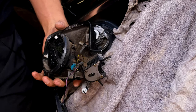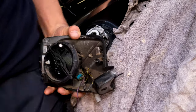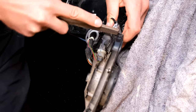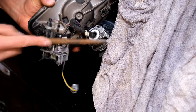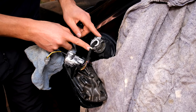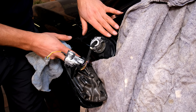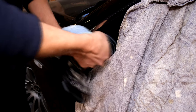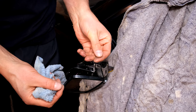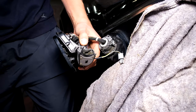On this side I'm going to follow the same process and take away the excess paint. Then I just take a blower and clean the surface with 90% alcohol or lacquer thinners. Just do not spill any thinners on the car because it will remove the paintwork. Because there's sometimes oil on fingers, I clean my fingertips with the lacquer thinners or rubbing alcohol as well.